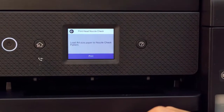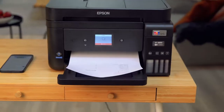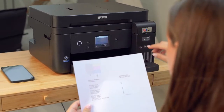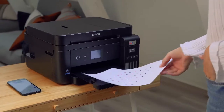Now we are entering the final step of the setup process, which is the test page set up to get the printer ready. First off is the nozzle check pattern — check the printed pattern to see if there are gaps in the lines. If you have no gaps, select finish and press the OK button. After that, there will be four more adjustment papers. Follow the instructions on the LCD screen on the printer and fill in all the correct values.